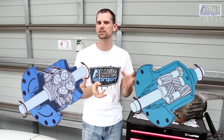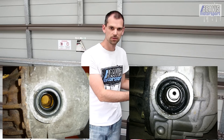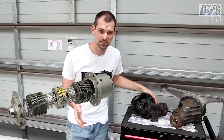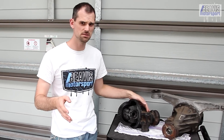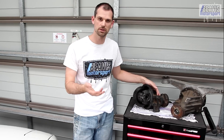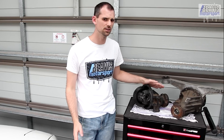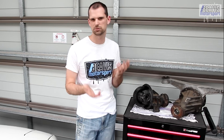The Type 1 is a worm gear type Torsen, whereas the Type 2 uses a sort of uniquely mounted drive gear. While they are slightly different in design, they function very similarly. The Torsen Type 1 has a clear hole all the way through the axle hole, while the Type 2 has a smaller opening through the middle. The Type 2 is generally considered to be slightly stronger. There are also Clutch Pack LSDs available for the 1.8 sized diff from aftermarket manufacturers like OS, Geiken, Kaz, and Cusco. While the Torsen differentials aren't really known to fail, the Clutch Pack centers are certainly more useful when you're looking at higher power levels — say over 200 horsepower at the rear wheels.